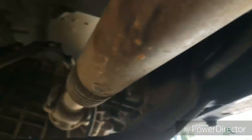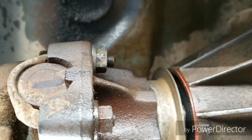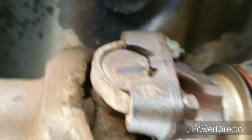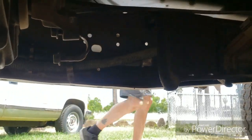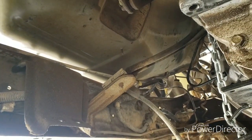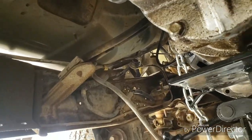Let's do the drivelines — they're just some u-bolt style retainers. I marked them with a sharpie so they go back to where they came from and don't get flipped around 180 degrees. I took the front driveline completely out just to get it out of our way — it seemed to just want to hang out and I didn't have zip ties big enough to hang it up, so just to keep it out of our way I took it all the way out.